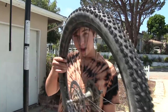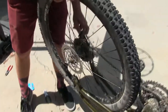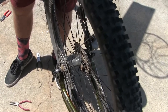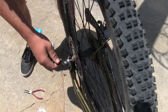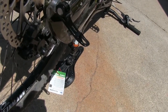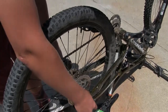All right, once you've ensured that there's enough space between the pads to fit that big fat disc in between them, you're just going to slide your wheel back on. And you should be back in business. We are in — so there's your new pads, you're in on both sides. Just tighten it back up, put your wheel back on, you'll be good to go. Thanks for watching, as always.